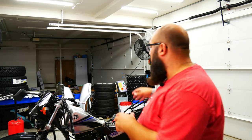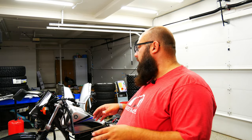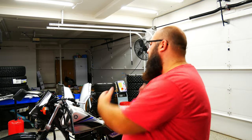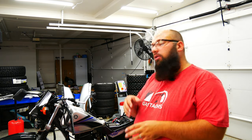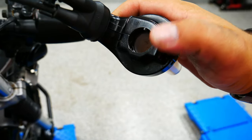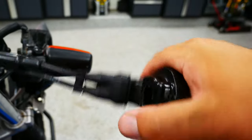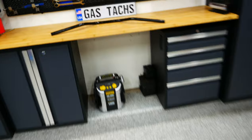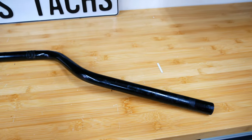After reviewing the situation, I've figured out I'm just going to drill a hole for that nipple — I'll show you up close what I'm talking about. That way it won't move with off-roading, which is obviously more aggressive on the bike. You don't want the throttle assembly slipping on the handlebar — that would be a pain. And since this is meant to be my rescue bike, I don't need my rescue bike to be rescued. So let's mark that and figure out what size drill hole we need. You see this little nipple here? That actually sets into the handlebars so it doesn't slip around when you're using the throttle.